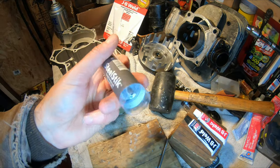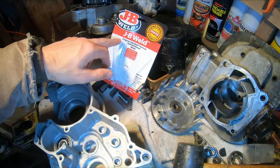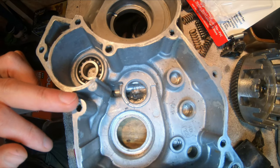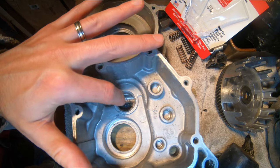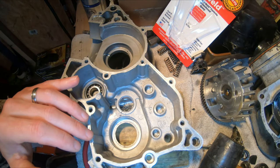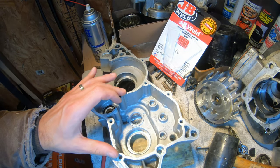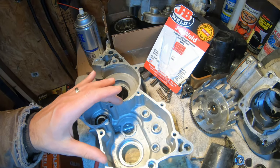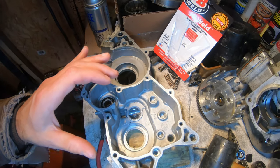All right, so the steel stick, for whatever reason, didn't work well - it didn't bond to the case, so it all came out in one piece. So I've gone to a classic JB Weld cold weld formula. What we'll have to do after this cures is go in with the grinder and clean it up, probably sandpaper just a little bit around the bearing race here. I did take this and clean it up in gasoline, trying to get all the oil and contaminants out of there so we get a good bond. We'll let this set up overnight - I think this stuff needs 15 hours or so - and come back again tomorrow and see if we got something.